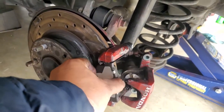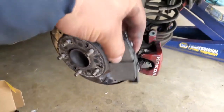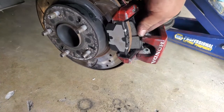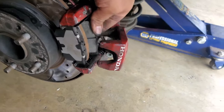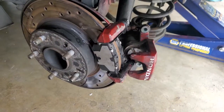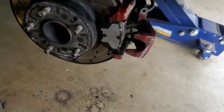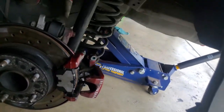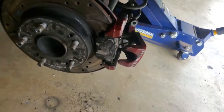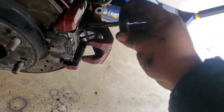We're going to go ahead and slap in the brake shoe — this will be on the exterior, and the one with the sensor will be on the interior, going downwards. Let's go ahead and insert this one right in there; they just slide into place with a little bit of pressure. Both brake shoes are in. Now we're going to hit them with the same synthetic brake and caliper grease, just where the caliper contacts them — no need to grease them all over. Go ahead and mark the back one as well, just like so. Perfect.